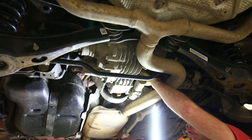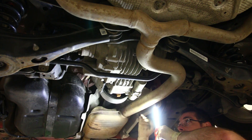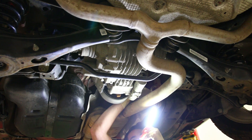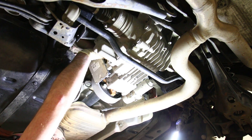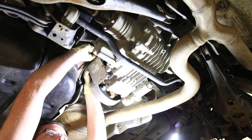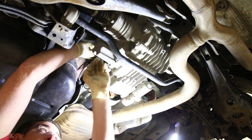When you're taking this pump out, there is a mounting for the harness — kind of squeeze it and push it through, and it will allow you to pull the harness from that side over. You're going to need to use that to disconnect and unplug it from the vehicle. The plug for the pump actually plugs in right at the top of this module, so you have to unhook it from where it snaps into the housing and then unplug it. You'll probably have to deal with a bit of dirt inside the connector, which means you have to push back on the tab and work the connector back.